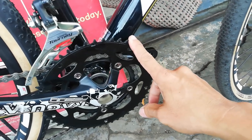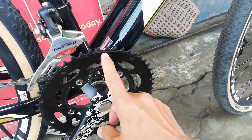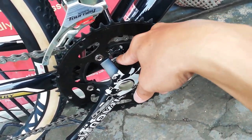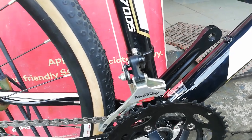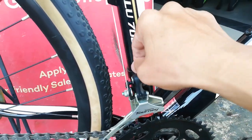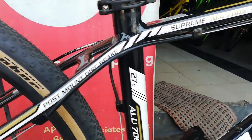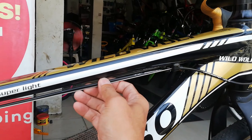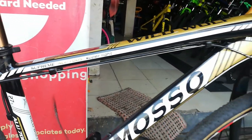The crankset is Ragusa RB900 - 'RB' standing for road bike - with square taper interface, alloy crank arms at 170mm. The chainrings are steel - the small ring appears to be 34 teeth and the large ring 50 teeth. The bottom bracket is sealed bearing. The front derailleur is clamp-type, Shimano Tourney, clamped to the seat tube. Cable routing runs under the top tube for the FD, RD, and rear brake cables.